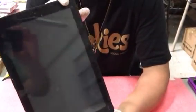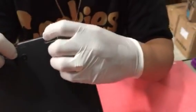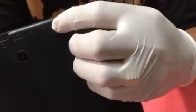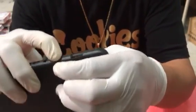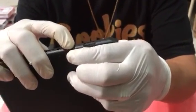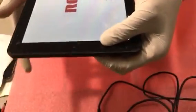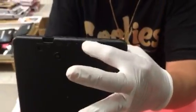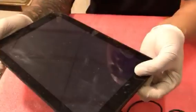Wait about a few seconds. Now what you're going to do is press the volume plus and the power button together. Hold it down like this, and then once the power is on, release the power button. Keep your finger down on the volume plus and wait — it's going to come out to a menu.